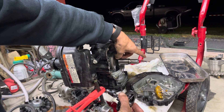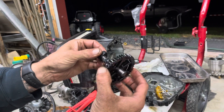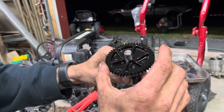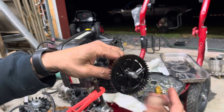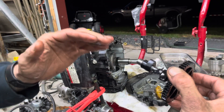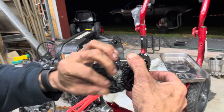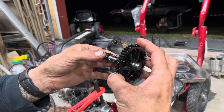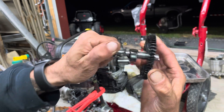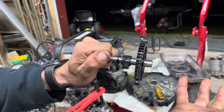Even though that one's keyed and it does wobble around, it should keep time. But this gear here is not going to keep time because it must have some sort of flat spot in here. I don't see any timing marks on it other than the actual gear mesh teeth. This is what operates the valves, and the valves weren't really hitting time every time — eventually it fell behind time and wouldn't create the suction because it wasn't opening the intake valve and the exhaust valve at the right time. It must have a flat spot on it. You can spin this gear, but that also means it can slip right out of time.